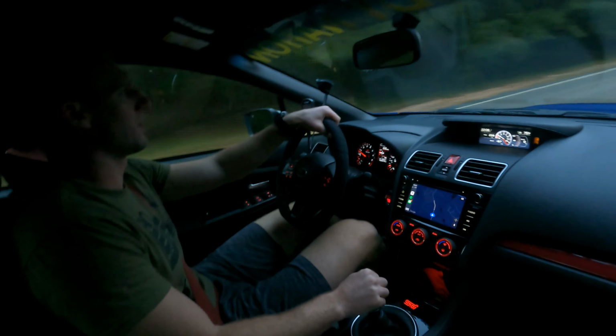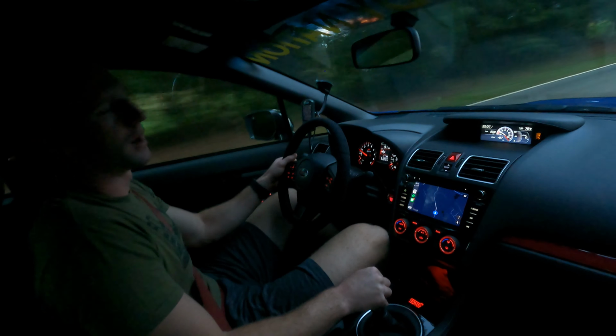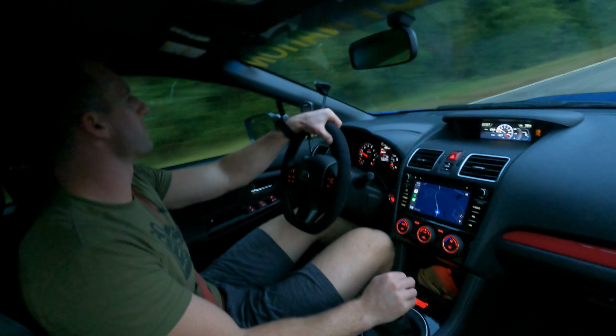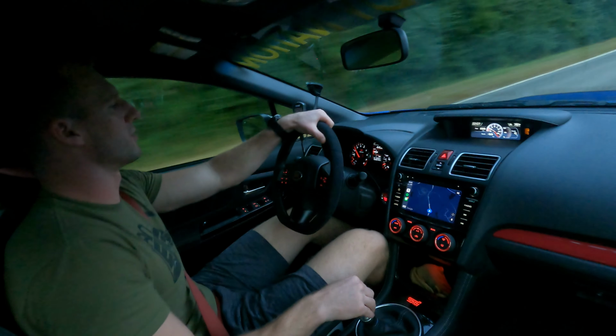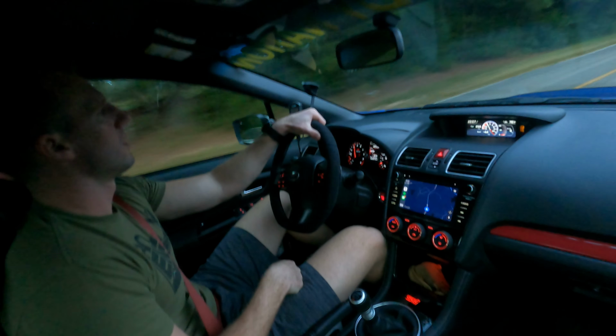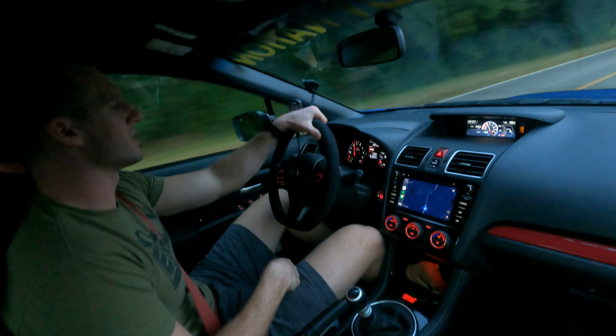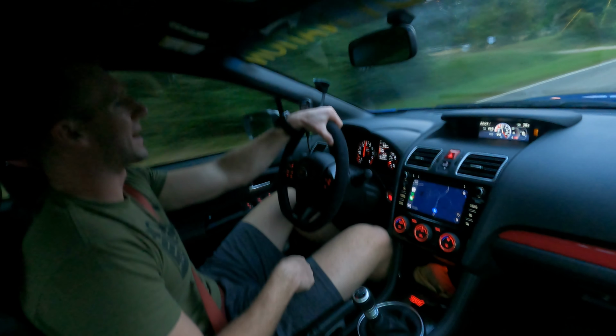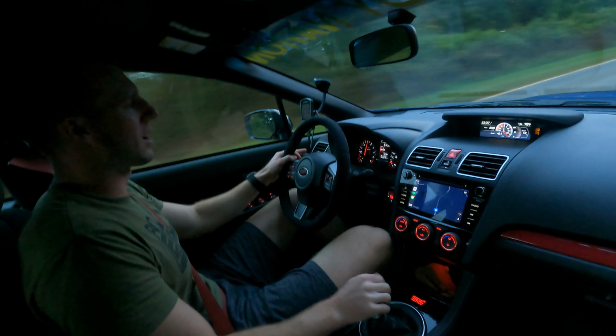I'm sure that person did not appreciate that, but I'll coast in neutral for a second. All right, so that was a 4th gear pull going from about 40 to a number that we're not going to say on here, and we were up to 86% injector duty cycle. So again, we are creaming those 1300s, which I wasn't expecting. So I guess 1700s are gonna have to happen sooner rather than later.